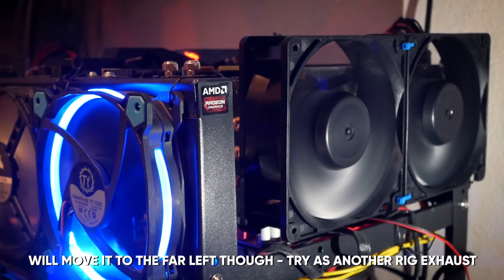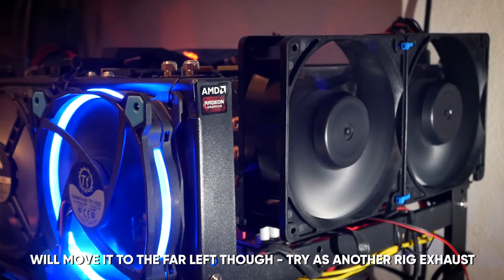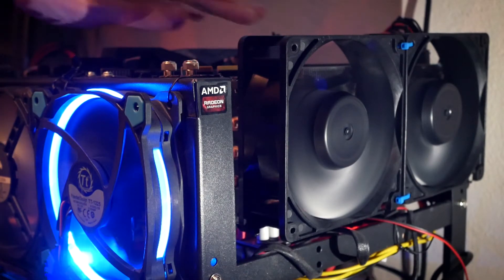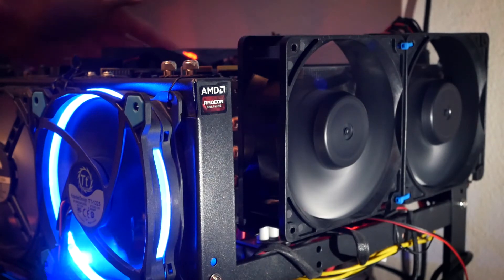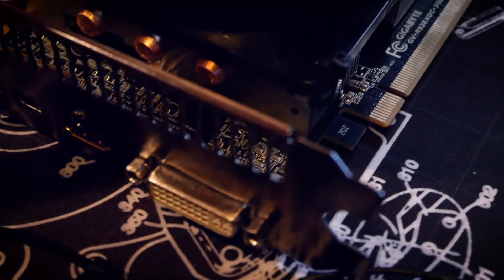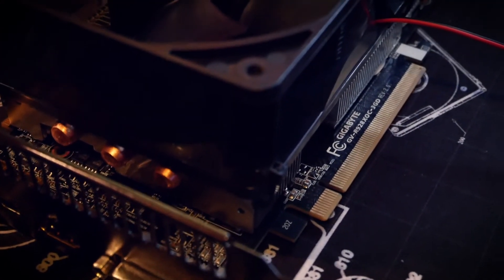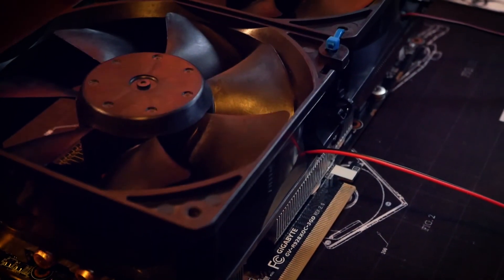The deltas are even blowing over the card to the rest of the rig, so it's actually helping generally with airflow. The R9 was the card heating all the other cards up because it just dumped heat all around it, so it looks ugly now but it's much better than before. We have built a custom cooler and dropped temperatures immensely — basically we turned this card into Frankenstein's monster, but the inside matters and it's much cooler. Thank you for tuning in, have a nice week, please subscribe if you liked this video, and may your temperatures always be low. Bye!